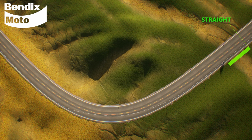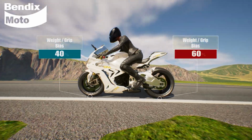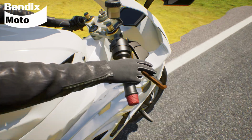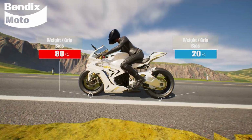On the road, we tend to accelerate up to a speed we feel comfortable with at neutral throttle until we approach a corner. During this phase, tire grip and steering are neutral, with the motorcycle balanced as we position for best vision and corner entry. As we shut the throttle and enter the initial braking phase, we adjust the bike to an appropriate speed for our skill. In this example, we use around 30% of the available brake performance, slowing down at around 0.4 G.